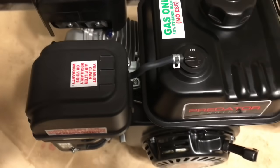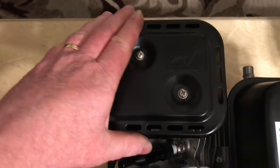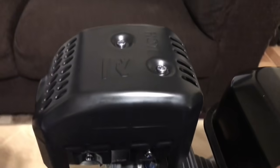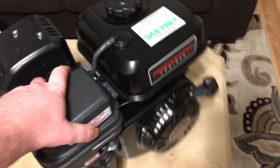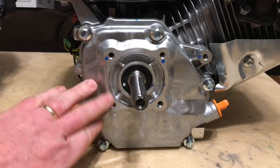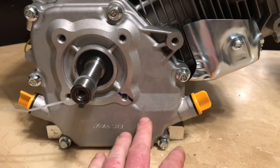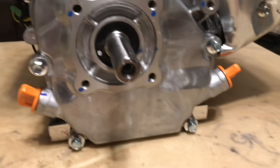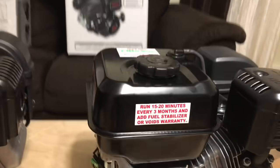Looking at the airbox, this one drops down here and this one is straight across on top — the airboxes are quite similar but different. Even more different is the exhaust: one is quite flat versus the other which tapers off. Coming around to the other sides of the engine, in the back you'll see the side cover — one is a smooth aluminum casting and the Hemi has more of a dull matte gray casting. There's also an identifying number on one but nothing on the other.